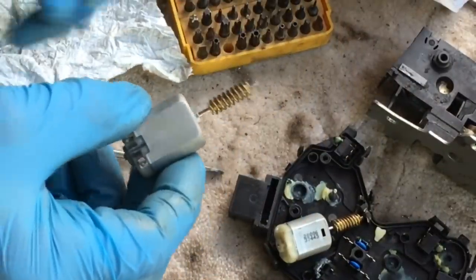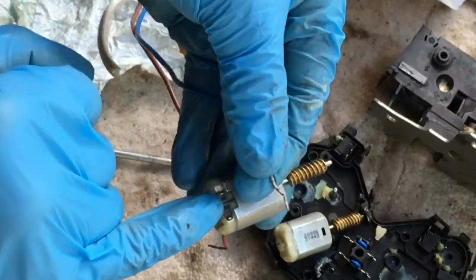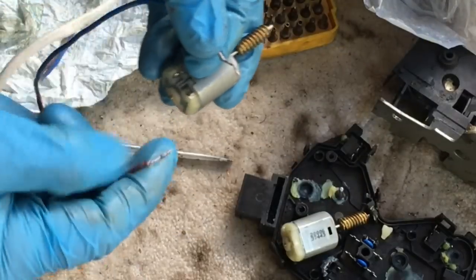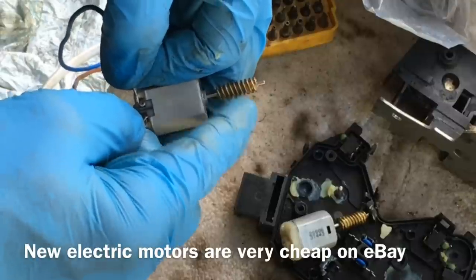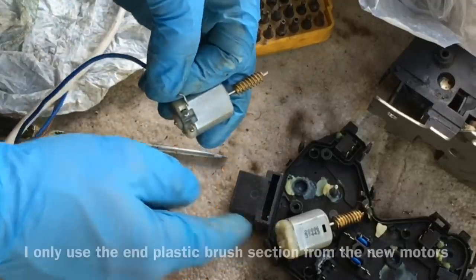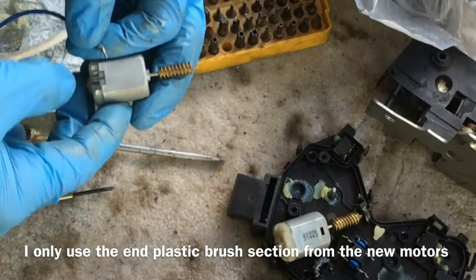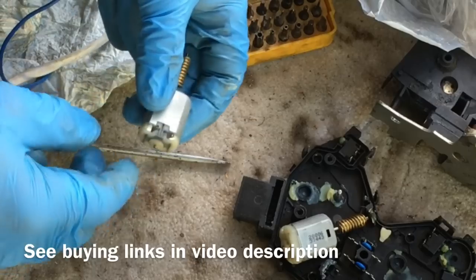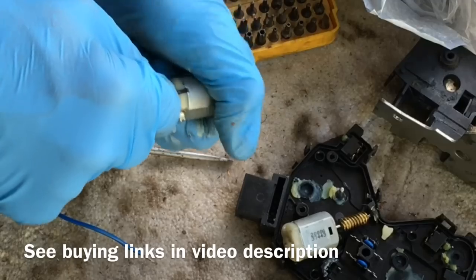Let's test the motor by getting some wires from a power supply or a 12-volt battery, putting a couple of tags into the little slots where the connections go. Those tags I got from my bag of new motors. This one doesn't work - you can feel it twitching a little bit as you rotate it. Obviously the brushes or something have gone. The other motor seemed to be working fine - even holding the end it would rotate strongly. So let's take this one apart and see what's wrong with the brushes. We need to lever up these metal tags on the body of the motor.